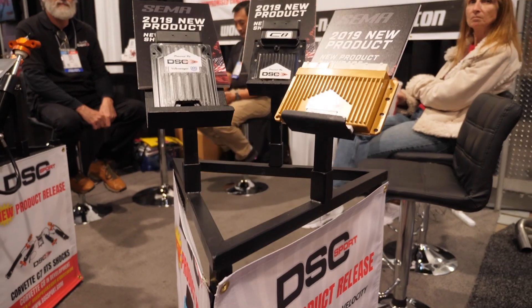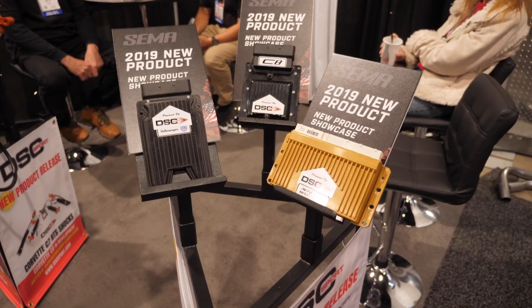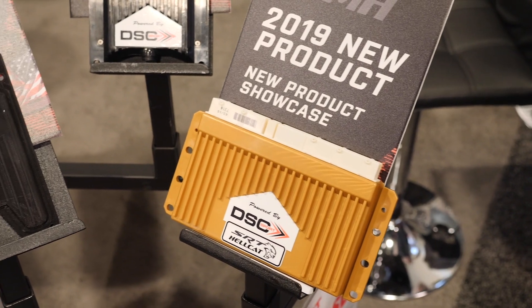We're always looking for a G-force signature and that table is pre-written by us — every controller we sell is already mapped very well. The other sensor that comes into play is brake line pressure, because in a braking event the brake line pressure rises before the G-force. We use brake line pressure to pre-amp the damping force before the G-force actually occurs.